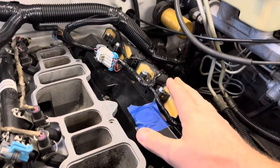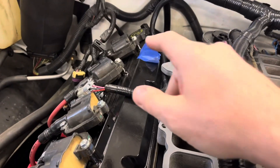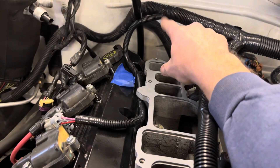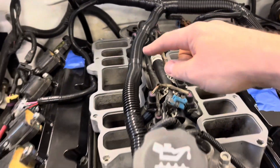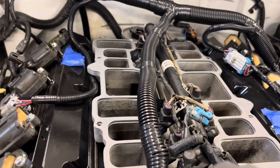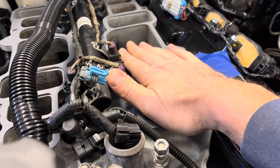There's one trigger wire for each coil on both sides, and then there's a low reference wire for bank number one and a low reference wire for bank number two, which run back to the factory harness. I peeled back the corrugated tubing — well, tried to; most of it broke. So I pretty much replaced it from about where this splice is all the way down here. All of this new section is fresh — I had some of that stuff in the basement and just used what I had because the old stuff was cracking and falling apart. I had these intake ports covered while doing all that work to keep any junk from falling in.